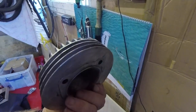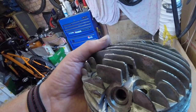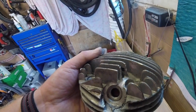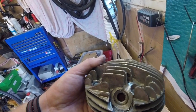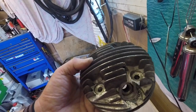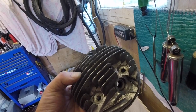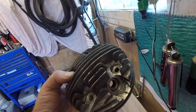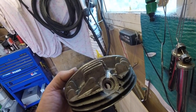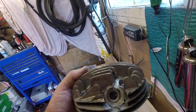This is an old head — I'm using a mammoth one now. Hope that helps. I would not ride without it now. I'm convinced it's saved so many nip ups. When you're getting up to 300, certainly on the cast barrel — 350, 360 — stick it on, it'll drop it down another 20 degrees or so, and you know you're in the safe zone. You know it's not going to seize up and you're not going to blow it up.